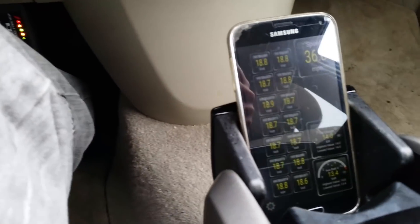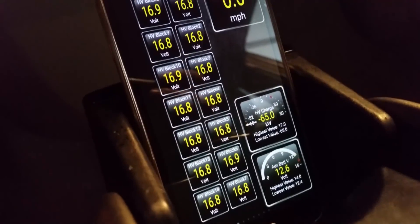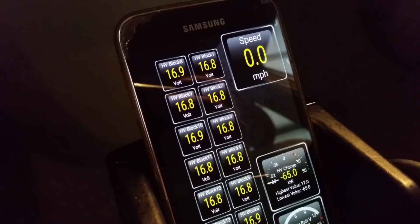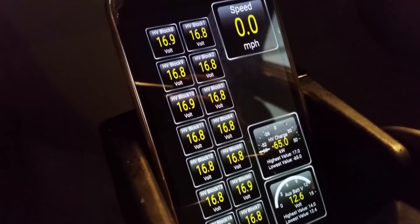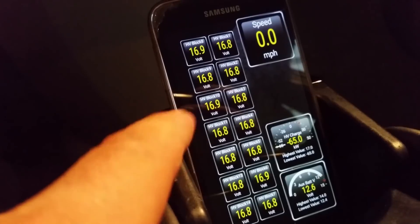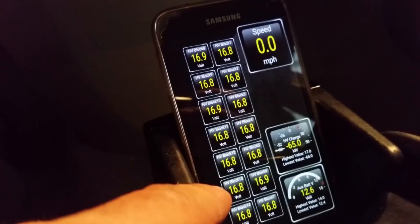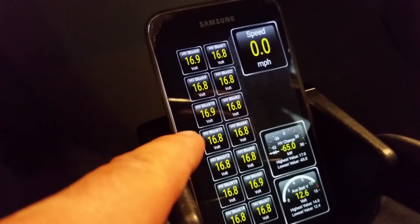You can see the voltages are staying very high. As a recap after two weeks of driving, all my voltages are staying pretty solid with the car off at about 16.8–16.9 volts, and that's what you want — you want them all to be very even. What I found throughout this process is if one of these blocks drops below a volt and a half of all the rest, that's when it throws your red triangle of death and your check engine lights.